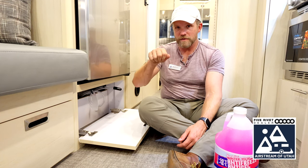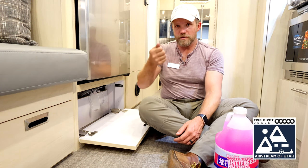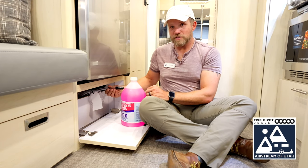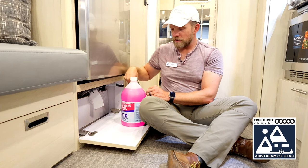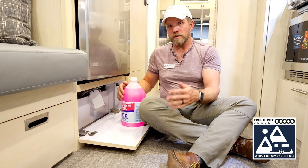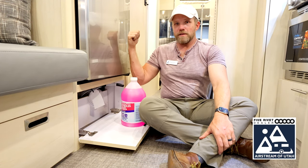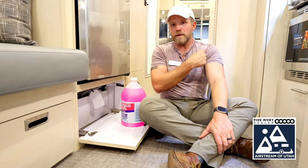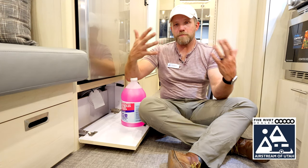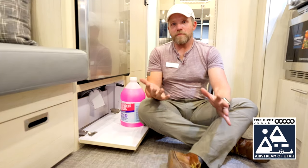The tag shows a diagram of a valve you can turn. On the very end of the hose, right on the inlet side of your water pump, is a 90-degree shutoff valve — either in line with the normal water line or in line with the winterization hose. Take the bottle of antifreeze, put the end of the hose into the bottom of the jug, turn the valve, and turn your water pump on. Then go to each fixture and turn the hot water spigot on until pink comes out, then the cold — doing the same for the toilet, shower hot and cold, bathroom sink hot and cold, outside shower hot and cold, and both low point drains. Once pink comes out of all those, your water system is completely full of RV-safe non-toxic antifreeze and none of your water lines will freeze.